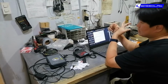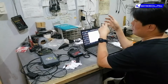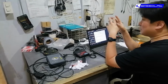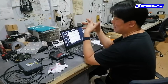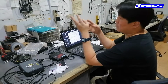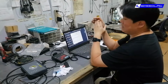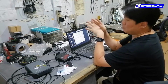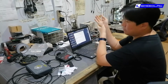Normally, most engines are tuned on the rich side, meaning that there's more fuel injected than what's required to make a certain amount of power. They do that for a lot of reasons, mainly because back in the 90s, fuel standards were all over the place. And again, our octane rating is different from what we use here and from what we use in America. So manufacturers, BMW, Toyota, Mitsubishi, they all have to pretty much put in a conservative fuel map to be able to run on any fuel. Say the car goes to Nigeria with 88 octane, it still has to run and perform.